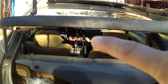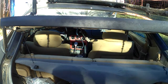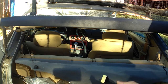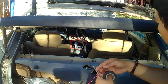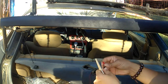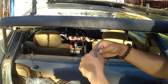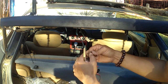Okay? See that white plug right there? I'm just gonna put two black, which is ground, and a red to the power on one of the holes, okay? And you can either go ahead and choose your mounting, where you're gonna mount the brake lights. I'm probably gonna mount it later after I get this done. So I'm just gonna lay the brake lights like right here, okay? And I'm gonna mount it later. And now I can just go ahead and finish the wrapping part. So my electrical wire is wrapped pretty good now, and I can just go ahead and finish wrapping electrical tape around it to hold it good before I plug it into the white plug and wrap it again. See what I mean now?